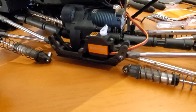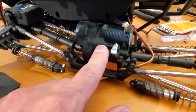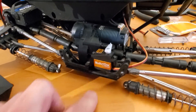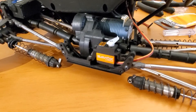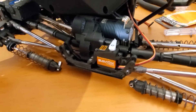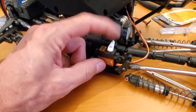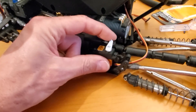You can see when I switched that from four-wheel drive to dig, this is not really lifting. That's why I think I'm okay without the servo protector, because I've had it on for a while just switching it back and forth and it's still not even really warm. I've had it on for probably 15 minutes before I started this video in the four-wheel drive position and it's still not even warm.